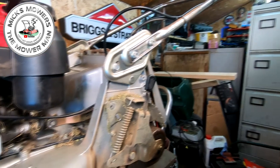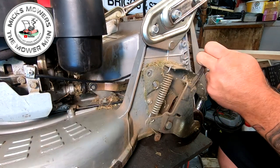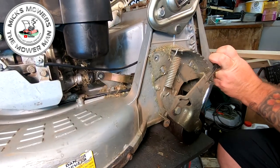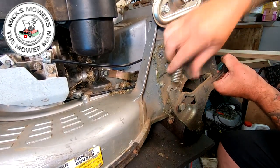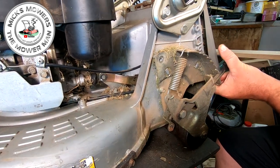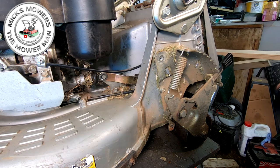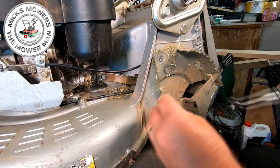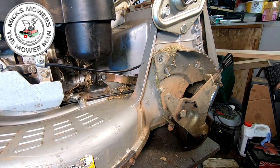Right. Next thing you want to do is you've got a spring here to remove, and the best way to do that is to make sure that your spring is at the least amount of compression on the highest setting, which would be about there, okay? The spring's quite loose, but you can go out just a little bit further, and it will enable you to remove that spring with relative ease. Just sort of hold it together and do it in one hit. I'm trying to do it one-handed here. Or you can get yourself a pair of, I find, fuel hose pliers to be quite good. Just get hold of it underneath and then just prop it up and it'll come off like that. So that's the spring. That goes into your magnet tray, like so. That's that bit done.